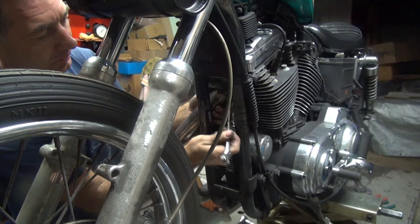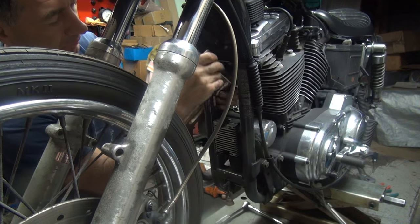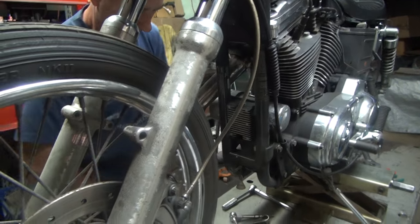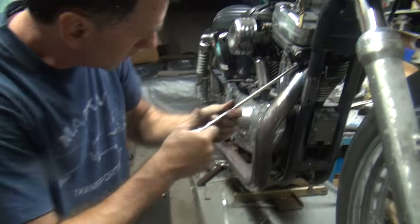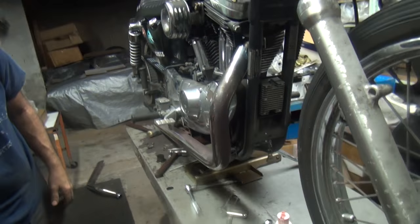See, if you have the double box wrench, it has an offset to it, and the kickoff clears the frame. If you have the flat version, like a combination has, then it bottoms out and the frame doesn't work as well. Okay, see the torque we're putting on that? That's about right. You can just keep going and strip it out if you want. Oh, that sounds like a really good plan. I thought you would. Pretty tight now.